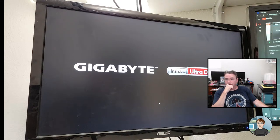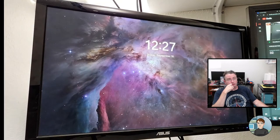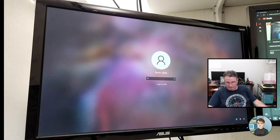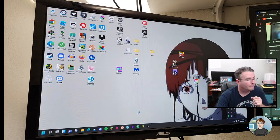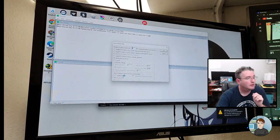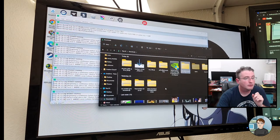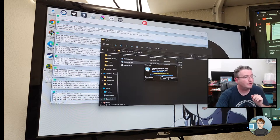Booting into Windows. Yeah, a little smoke. That's what we'll do. If 3600 megahertz still crashes, we'll knock it down to 3200. Back to downloads, and Prime95, that's the zip file, Prime95 folder, and disabling AVX to keep it cooler. And HWiNFO64. Yeah, there's HWiNFO64 and HWiNFO32.